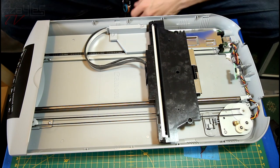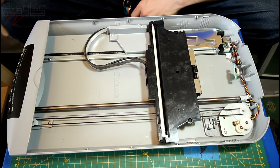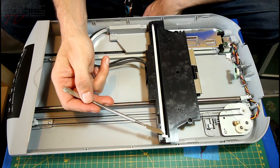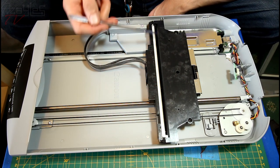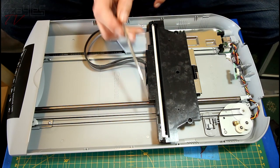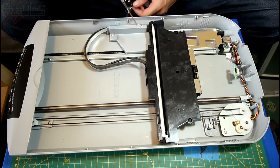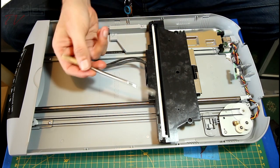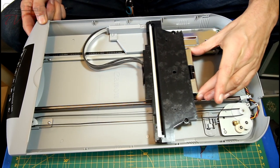Right, first thing, and I could have expected this after the top thing, was a vacuum fluorescent tube or a cold cathode. A CFL tube for sure, I should say. This one is also a CFL tube. So this gives out the light, hits the page, whatever you're scanning, the light goes back into here. And then it looks like there's going to be all sorts of mirrors underneath it that go to a sensor, which is, I'm guessing, this end.